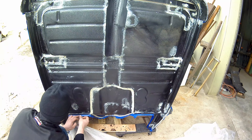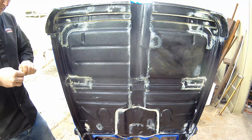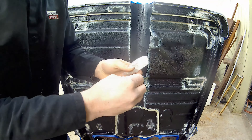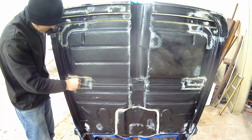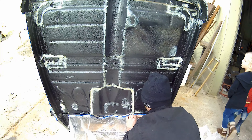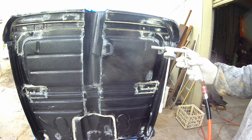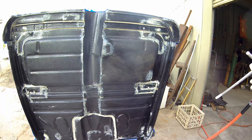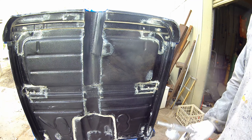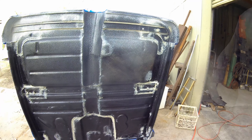That in turn prevents our material from having a very hard edge. For holes without threads, we're just going to tape the backside. For holes with threads, we're going to ball up the tape and push it into the thread. Make sure that you don't have anything hanging off that's going to get caught up underneath the undercoating. The product I'm using today is a 3-to-1 mix ratio spray-in bed liner, and it's white — it's a leftover from a previous project.